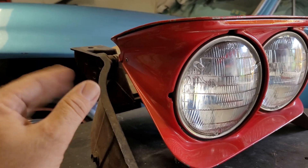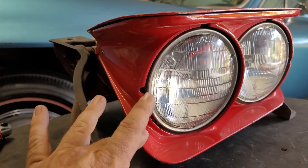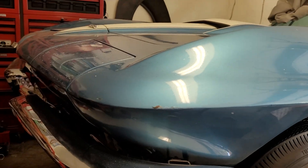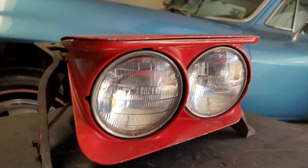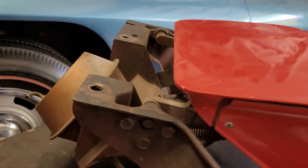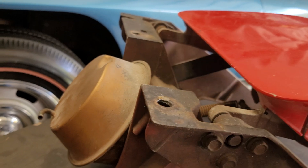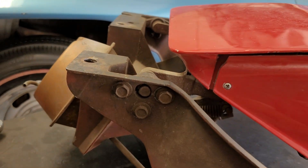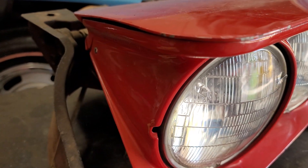Notwithstanding the fact that the body panels are glued together and there are other complex things, these are the kind of things that make even grown body men cry trying to put them back together. In C2s you have to remove the lower grille and the hood to get the headlight assemblies or motors sufficiently out of there. The C3s add another layer of ridiculousness because the entire mechanism is controlled by vacuum - here is this vacuum pod. A C2 headlight is electric, C4 headlights are electric motors, C5s are electric. This is the only generation - for 15 years - they subjected us to these vacuum pods.